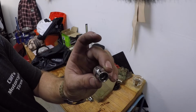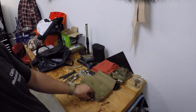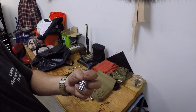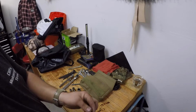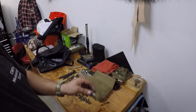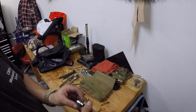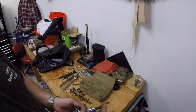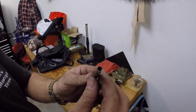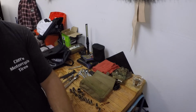10 millimeter 12 point for your front calipers, and then your Torx bits. I think a 25, a 27, and a, what's this other one? A 15. And then my 3 Allens, which is a 4 mil, 6 mil, and I believe an 8 mil. So. Then I got this guy. It's a key. What it is, let me turn you around.